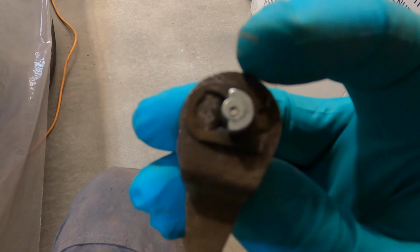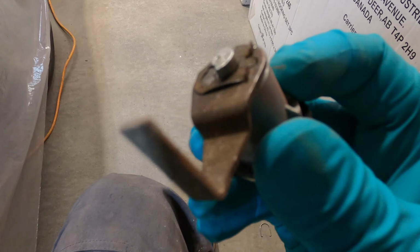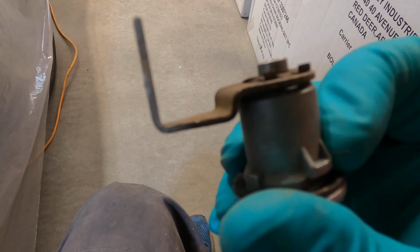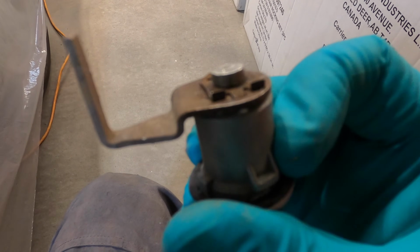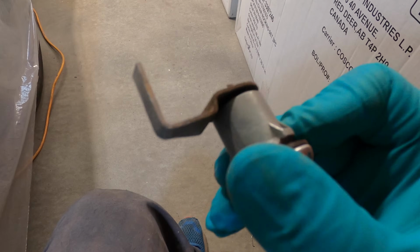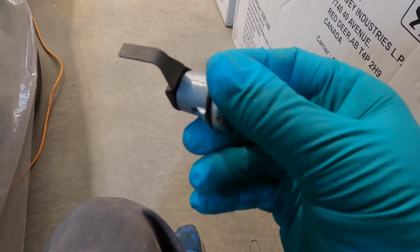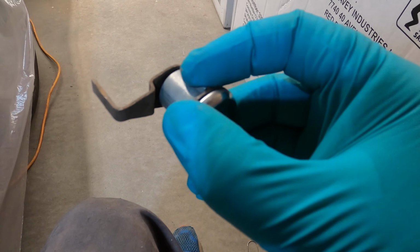You have to switch this stuff over. So this C-clip kind of deal, you have to unclip and push off, and then it pulls out the top here, and then this arm, it pulls off once you get the clip off. Hopefully that makes sense. But now to insert it, you have to insert this into the hole first, kind of maneuver it, and then there's 2 bars. Let me show you. Welcome to the inside of the door.